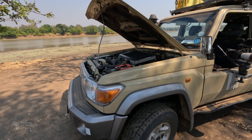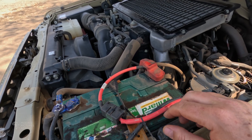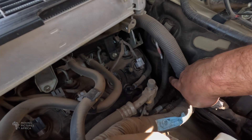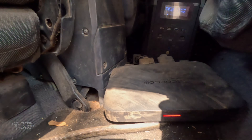I'm not going to do a full installation video because there are plenty of those on YouTube, and because I've just done a quick temporary installation here to test the system. It's a very easy installation: you attach the negative line to the negative on your battery, the positive to the fuse, and then this short fuse cable to the positive on your battery. Then you just have to find a way to run this heavy armored cable to wherever you're going to have your EcoFlow unit. In my case I sent it through the firewall and it comes through by the passenger feet, threaded back behind the driver's seat. Here is the alternator charger — I've just put it on the floor.